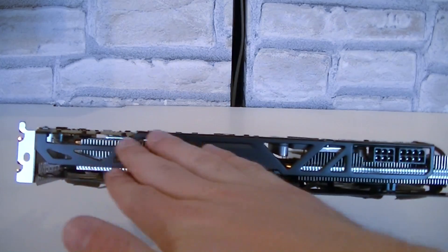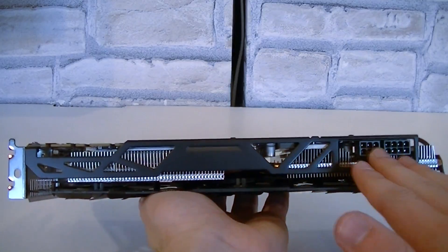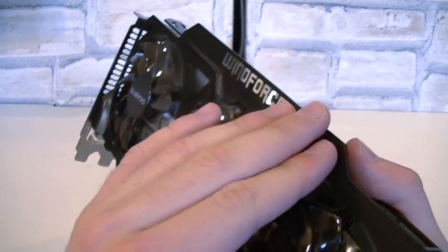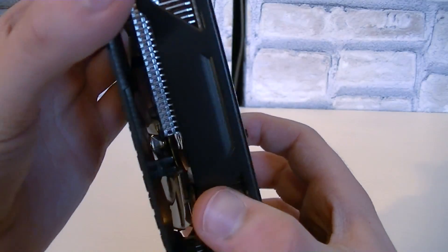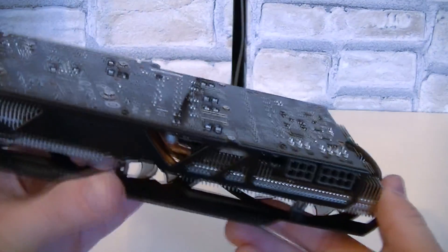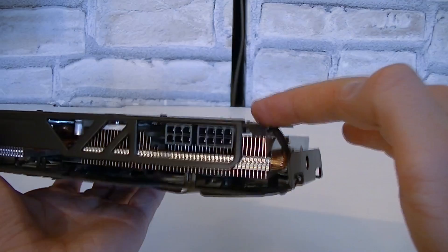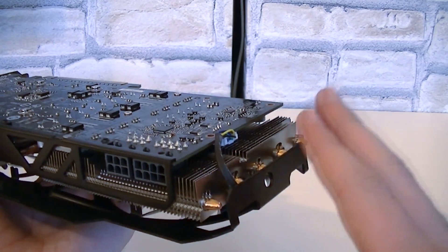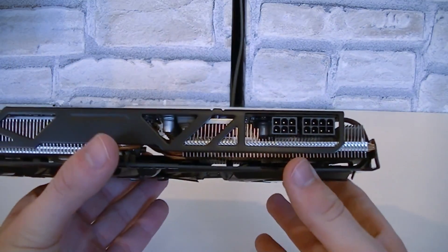This is how the card will be installed in your system. The shroud looks fantastic, though the Windforce logo extension is something not everyone will like. Unfortunately, the metal shroud is not secured all that well since it moves around a little bit, but that's not much of an issue. As you can see on the rear, the PCB doesn't fully match the length of the card. To pack even more aluminum for cooling purposes, Gigabyte apparently decided to extend the card a little. Just be careful — the graphics card may not fit into everyone's case at roughly 28 cm in length.